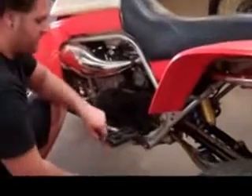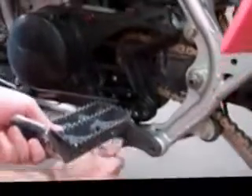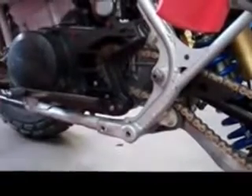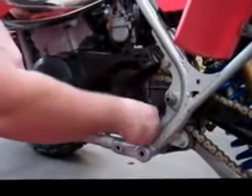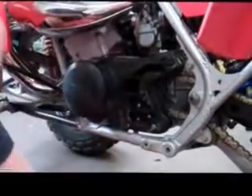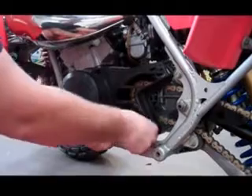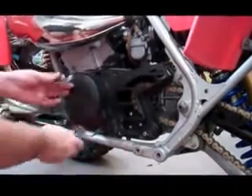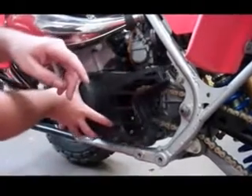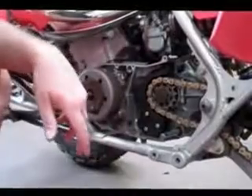We're going to get the side case off so we can get to the flywheel. To do that, we need to remove the foot peg and the shift lever. The foot pegs are aftermarket and the bolts are 14mm. You need to remove the bolt for the shift lever — that's a 12mm. Then remove the four bolts on the back of the cover, and then the three longer screws that hold the front. Everything is the same length so no need to mark them. Then you can just slide the cover off. Since this is a two-stroke, the stator cover is dry, and the side case is plastic if it's original, so it all comes off real easily.